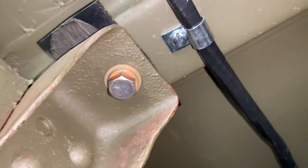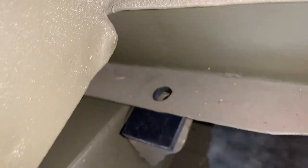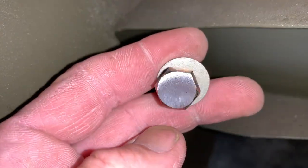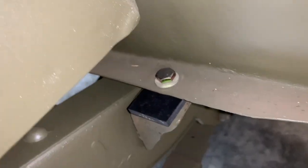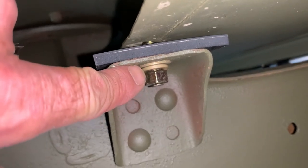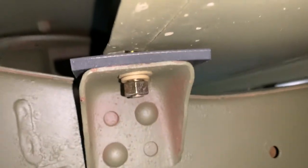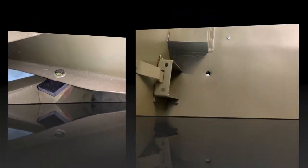That's the crossmember where your fuel line goes. Underneath the rear wheel wells, you'll see this lip that's right where the riser comes up near the machine gun mount, and this bolt is size 3/8-16 by 1-1/4 inch, and is inserted as shown into the bracket — again flat washer, lock washer, and nut. You will find an exact same location on the driver's side as we did here on the passenger's, and it will be installed the same way.